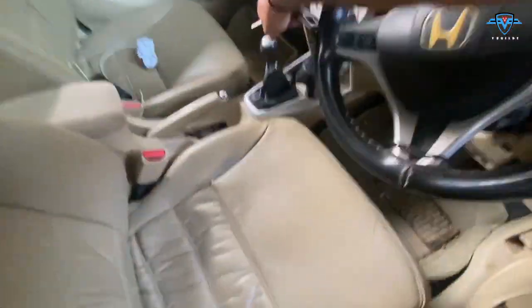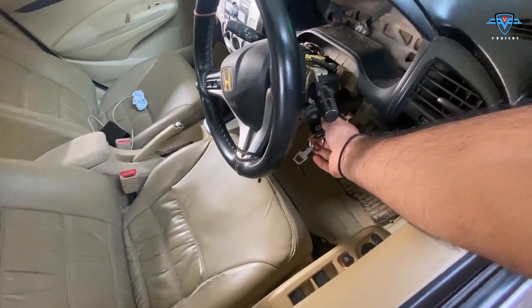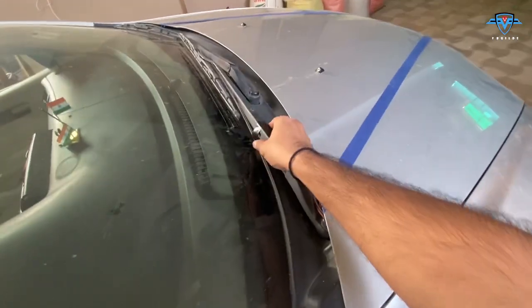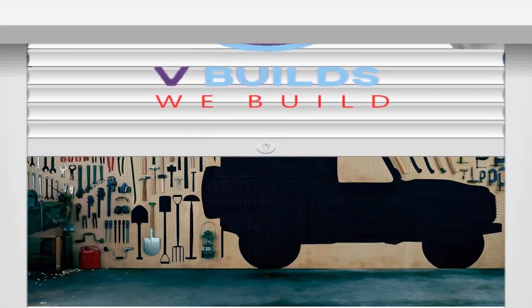Hear the voice - look at the fans, they both are working. Turn it off - fans off. And one more time: on, off. So that's how you bypass the radiator fans. Put it to neutral, put the key inside, turn it on. Turn on the fans - listen to the voice, those are the fans running, and you can take your car anywhere you want. Your car is absolutely fine, there won't be any overheating and it's safe to drive your car if you do it that way. See you in the next one, bye bye! If you like this video, please consider subscribing.